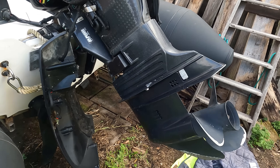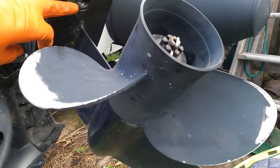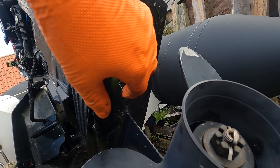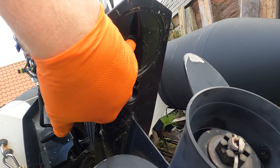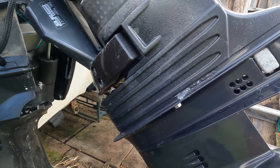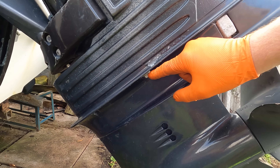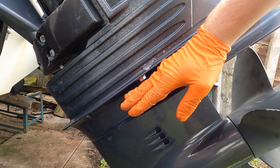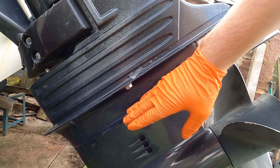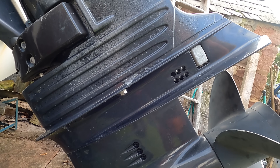The lower unit is about to come off. I've got one bolt left — we've taken the other three 9/16 bolts out. We've taken the central one off and there's one inside that's hidden by the trim tab. My next step is to take some slack off on this last bolt so I can see the thread, then tap the ventilation plate to break the seal. Once I'm happy it's going to come away, I'll remove the bolt fully and then the entire leg should come out.